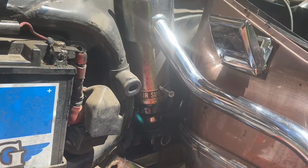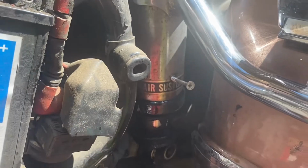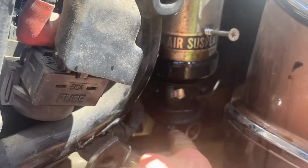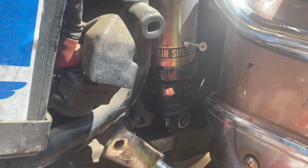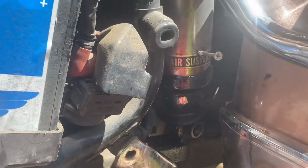And just a quick addendum to that. So this is the other side. I'm going to show you what I'm doing. So drill the hole, put in that screw right there. It's fixing this piston inside of the cylinder. So you can see down here, it's still kind of inside that socket. It's moved a little because I've already pulled it out and put it back just to test it, but it's still in that region. So the goal is to get it to come out of that region, and I found without the screw this just extends and it stays down there.